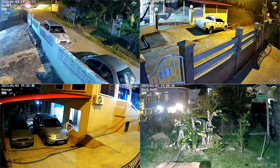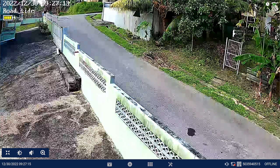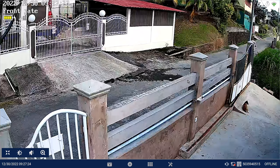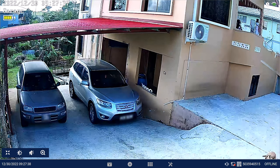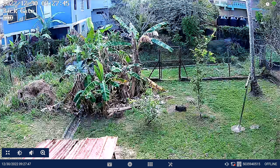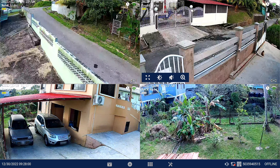For those of us who frequently check our monitors at the sound of strange noises, the standby snapshot screen can be a bit frustrating. The continuous recording mode works much like your standard wireless cameras; however, it depletes the battery much quicker and you run the risk of having no surveillance during the night. To facilitate a continuous stream, you can either connect a 5V 2A power adapter to its micro USB port, or a Type-C power adapter to its rear USB Type-C port for the solar panels. The disadvantage is that continuous DC power will over time compromise the internal battery integrity. Also, if continuous charging is applied to the micro USB port, you run the risk of dust and water damage because the waterproof cap is always open. And if using a USB Type-C power adapter, you would have to apply protective tape or an enclosure to protect the connector from the elements.